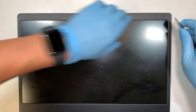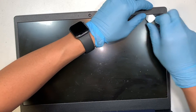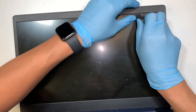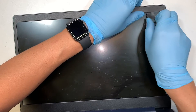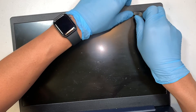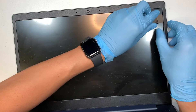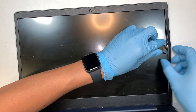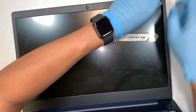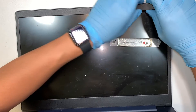You want to get yourself a metal prying tool. What we're going to do is pry open the bezel. Since the screen is already cracked, I'm not too worried about scratching it as we'll be replacing it with a new one. The bezel has double-sided adhesive tape on it, so I'm having some difficulty prying it open. The side here looks weaker — it doesn't have double-sided tape — so get underneath that and gently pry it open.